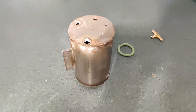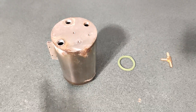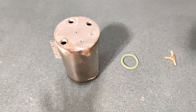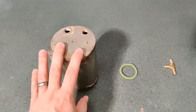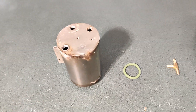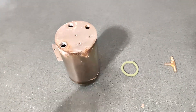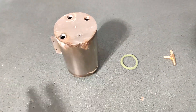So if you're having an issue with water not coming out of the group head roughly immediately, that is probably a sign there is a leak or slow leak happening in your brew boiler — especially if it sits for a while. Once it fills, the leak isn't fast enough to cause the issue again, so it'll probably come out immediately after that.